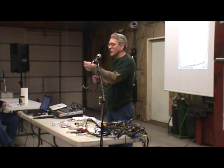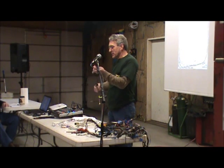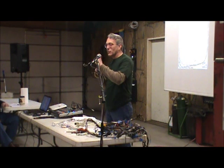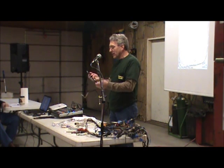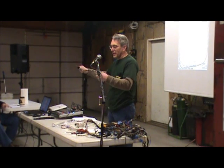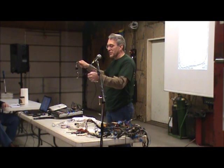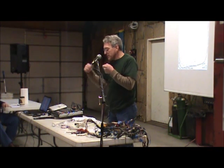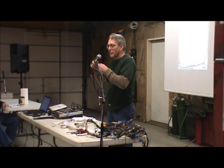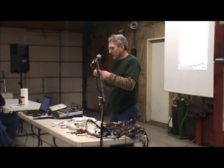It's got the proper terminations on it for bullet connectors and for spade connectors. A single strand that would run out by itself was in a sleeve. Got a good fitting grommet if I had to go through a bulkhead. It's all wrapped with the non-sticky tape. And at the end of the termination, a single turn with black tape just to seal it all up, because with the non-stick tape, when you get to the end of the run and you stop, if you let it go, eventually it would creep backwards and start to unwrap itself. So you have to have something that finishes the job.